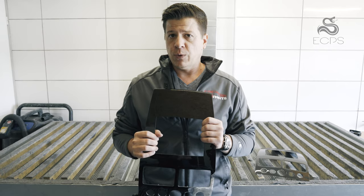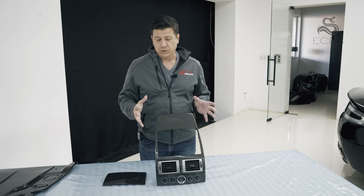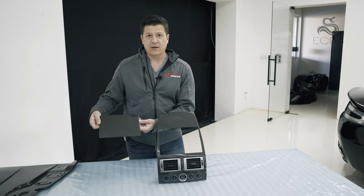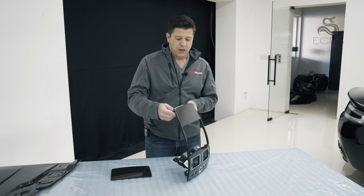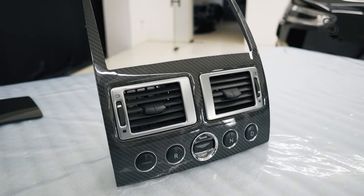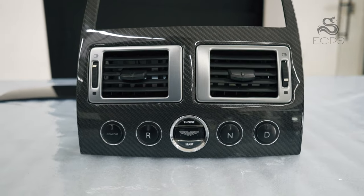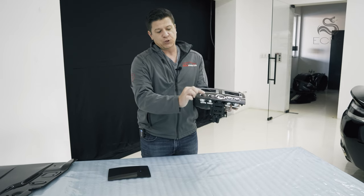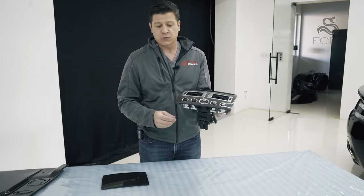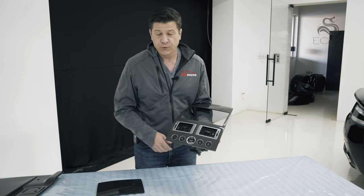If you are interested in this, you can do it yourself — I'll have instructions on redpants.lol — but I would highly recommend leaving it to the professionals and sending it here to ECPS. This is the end result, with a custom larger opening, but you can see the finish of the veneer itself. This is actual carbon fiber veneer that has been overlaid, the edges have been sealed, and it was finished so that everything fits properly. If you don't do all that prep work and grinding, the buttons and vents won't sit right because the panel will be so thick you can't push the buttons in far enough to clip them in place — they'll be loose.